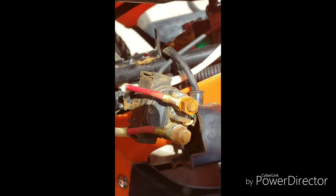When you press the button and just get a click, that usually means it's a solenoid. Lock the brakes here — you should get a click. That's a weak solenoid. We'll go ahead and swap that out. That's a 10mm bolt holding it in.